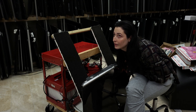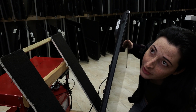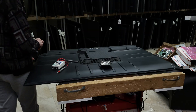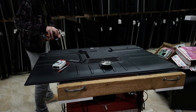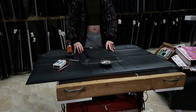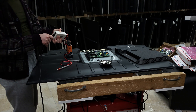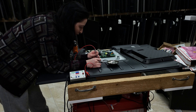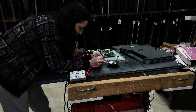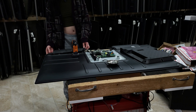You hear that? If you will notice, there's really no bezel — it's just TV straight-on metal. So this does make it a bit trickier than your standard backlight repair. We're gonna get this guy unscrewed. Different issue. Just gonna check with our backlight tester, and very easy — there's only one connection really. Anything? Nothing. Did shock myself a little bit, but still nothing. So in the meantime, let's finish getting this thing taken apart.